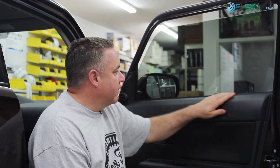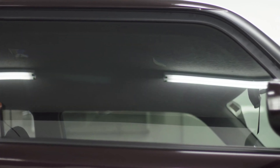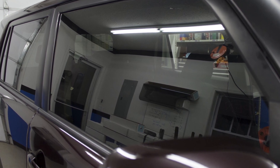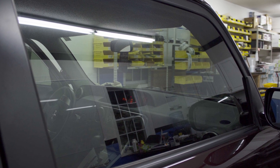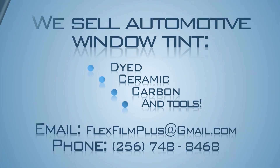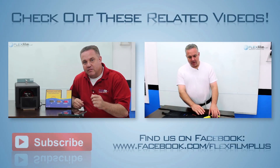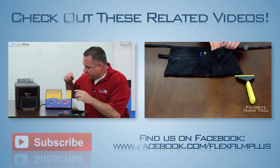For our last inspection, let's look at our top edge. I did not use any sort of shaving technique or filing technique — I just paid attention to how I cut my edge and was able to take a little time and line it up appropriately. A lot of people find this acceptable. There actually is a gap there. The film's laying down appropriately — flat, with expansion gaps. Everything's there like it's supposed to be. Most people find this acceptable. I wanted you to get a close up of the gap and how it looks, and the fact that we can now roll the windows up and down with this method — we don't have to wait three days or three hours. This window was just tinted about a minute ago. Thank you very much, and I hope these tips have helped you with your two-stage technique. We'll see you next time.